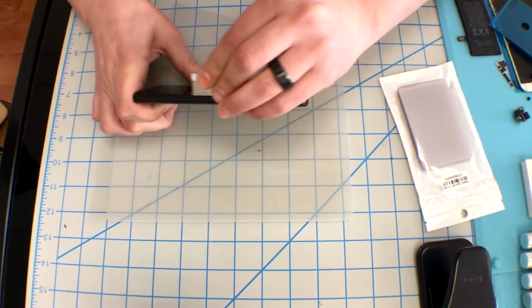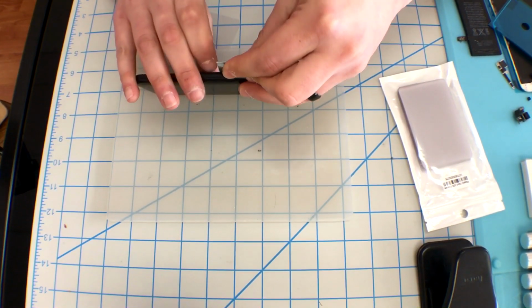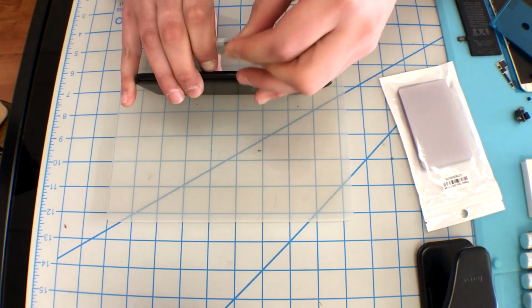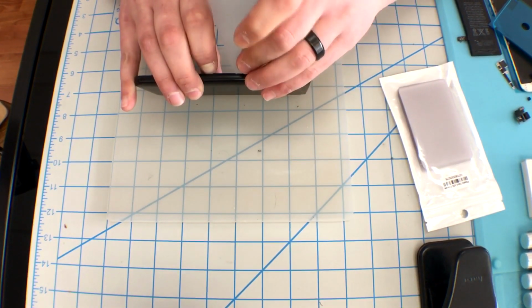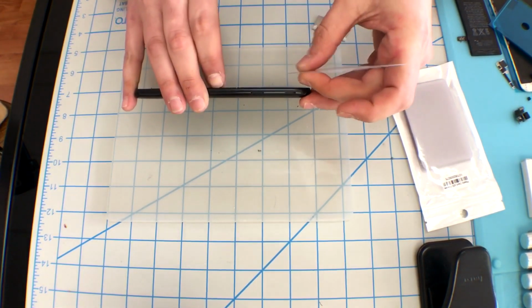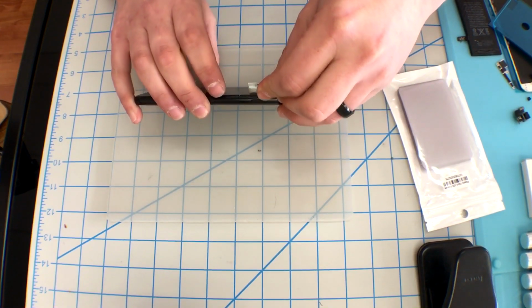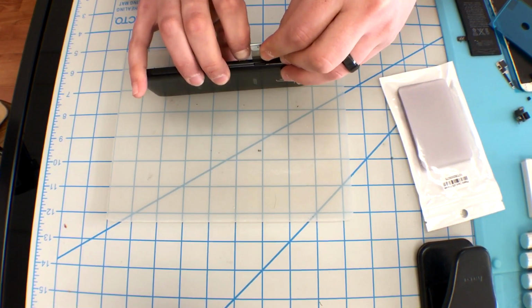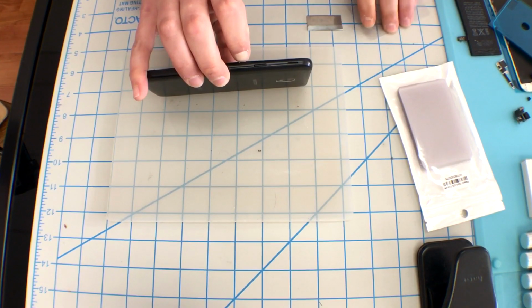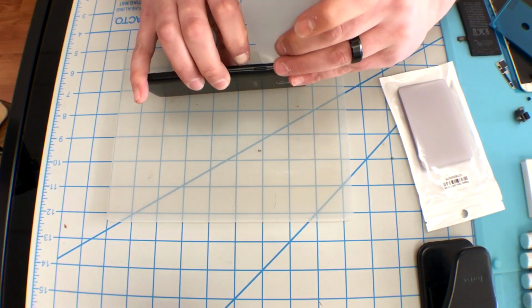With the heat gun, you can go around the edges of the glass, allowing a razor blade to gently lift one of the sides, giving enough clearance for a plastic card or playing card to slide underneath. With that heated up, you'll go all around the edges. I generally say start from the bottom. The sub-key buttons are recessed enough to where you generally won't damage them as long as you are careful and use a brand new card starting at the bottom.